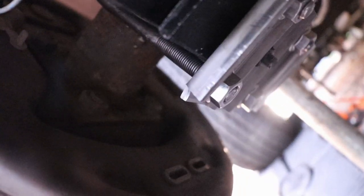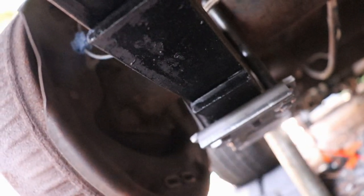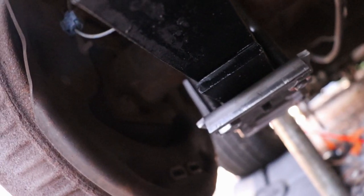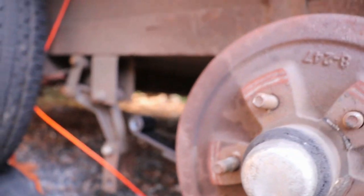All right, there we go. So this is the new spring here, and this is the new bracket and new U-bolts. One thing I want to point out — you don't want to tighten everything up until you get everything put completely together, especially with a platform like this. If you tighten one bolt all the way it's going to make the other sides uneven. So you've got to tighten them all evenly — do one a little, do another one a little, and once they all get pretty tight then you can ratchet them down. Pretty much got the spring on. Got to connect that side and then we'll be all good.